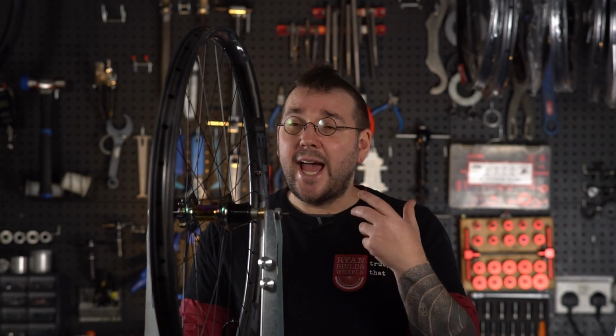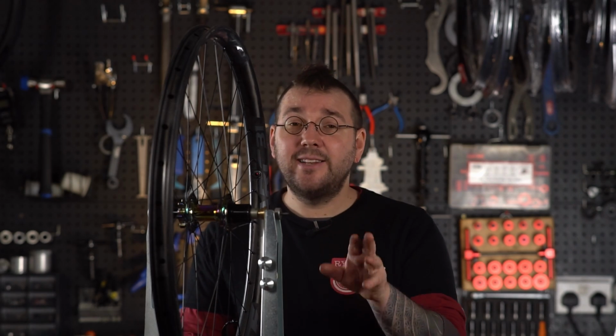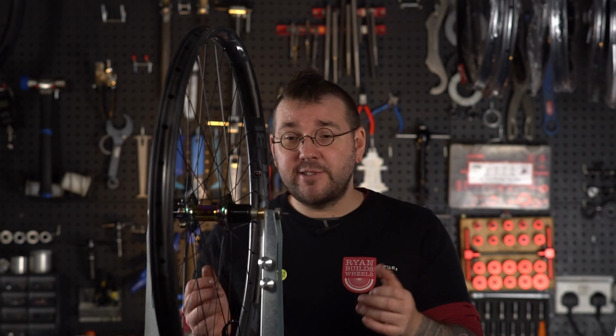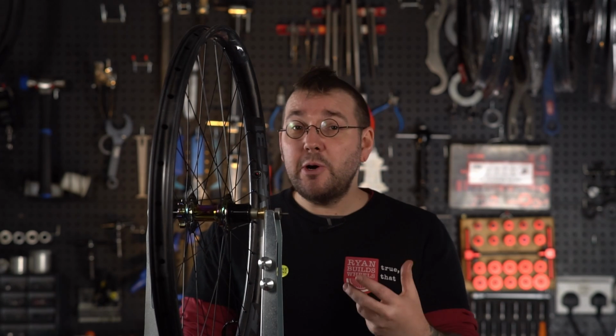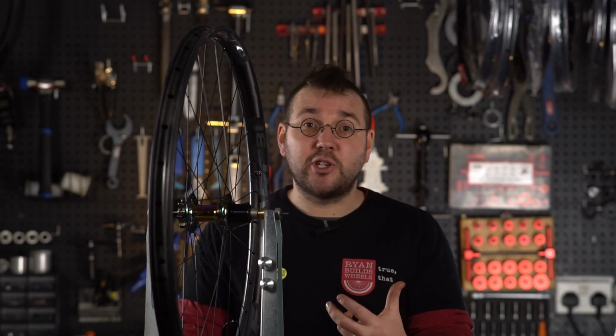We're going to be adding a final amount of tension to our wheel and learning about tension balancing. A wheel can be true, but it's vital that it's tension balanced. As you go through your wheel building career, you'll be cross-referencing all of these different things, tension, radial true, lateral true, to inform each other and to build faster. For now, I want to teach you the building blocks of wheel building so that you can self-teach more effectively in the future.